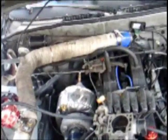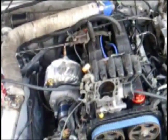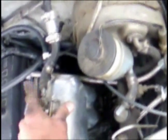So at this point, I have all of the injectors seated, and I'm really only about 5 or 6 minutes away from being able to start it back up. I just need to install the throttle body, the cold start injector, hook the upper intake charge pipe back up, and hook the throttle linkage rod up to the throttle body. I already re-hooked up the brake line, the vacuum feed line for the master cylinder, as well as the throttle body line, which kind of gets in the way over here at the end of the fuel rail. So that's that. Hopefully the next one will be started up and running.